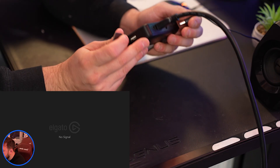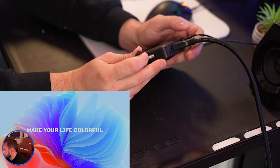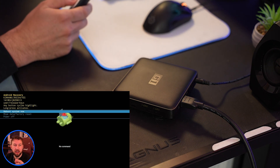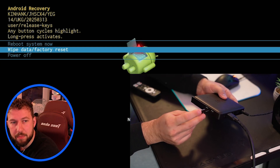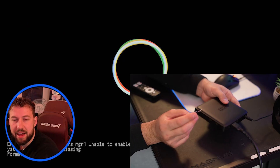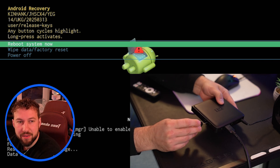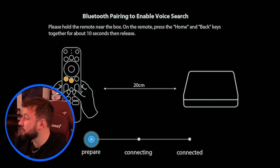Make sure both are held at the same time. I'm holding the reset switch down while I plug in the power. Keep holding it down — this is very important. Now you'll come to the reboot screen. With your remote, click on 'Wipe Data / Factory Reset.' Don't select 'Reboot System Now.' To navigate the menu, your remote might not work — you click the reset switch once to move around, and hold it down to select. Get to 'Wipe Data / Factory Reset,' hold the button to click it, then confirm. This will factory reset your device. Once done, hold it down one more time over 'Reboot System Now.' Your system will reboot and you'll be back on your main Google TV screen setting up your device for the first time.